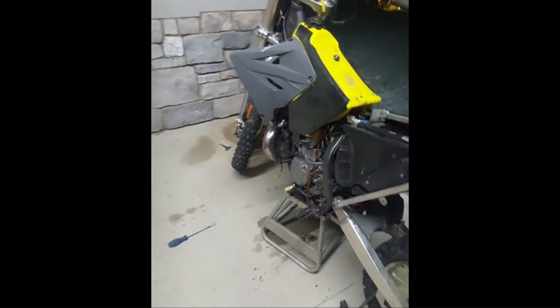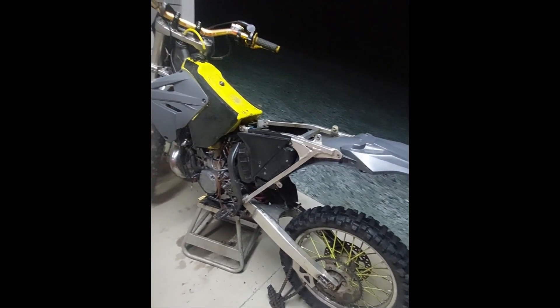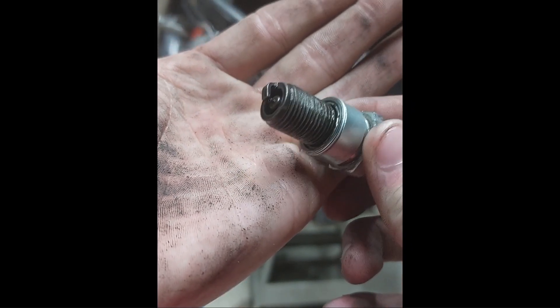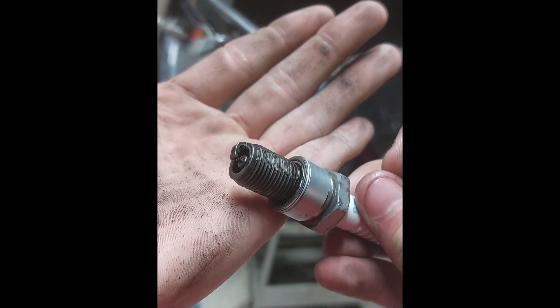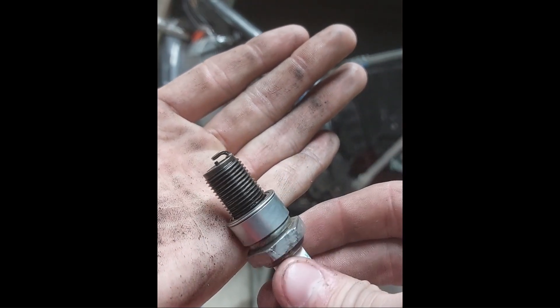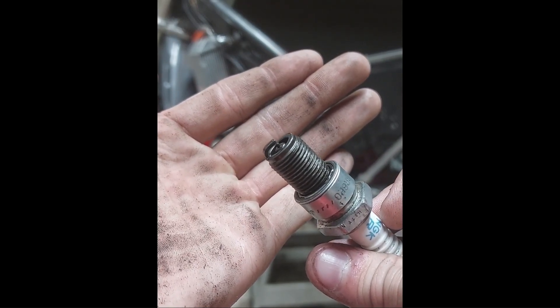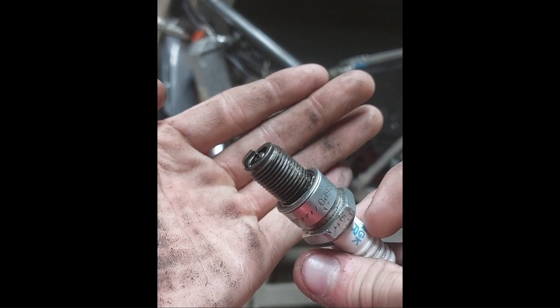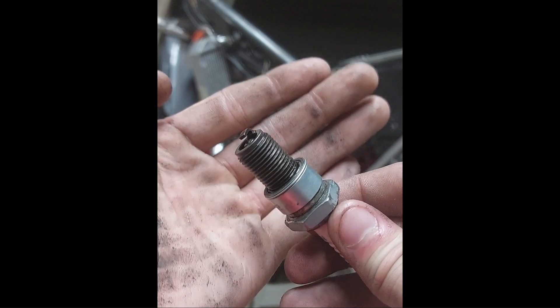Yeah, gas was just coming out of the boots. Let's fix up the wiring and tinker with a couple more things — but she runs. I pulled the spark plug out and it is soaking wet, so we're running a tad rich. Need to adjust the fuel air screw some more to get it right. The wiring is really old and I'll probably need to get some new ones, but we'll figure it out.